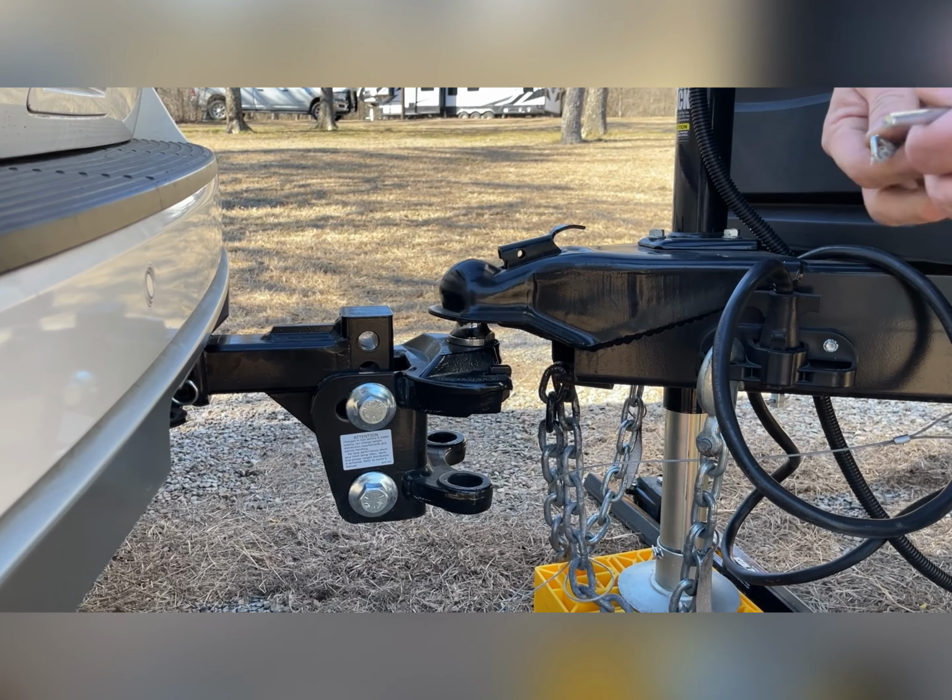Okay, you'll notice that it did release from the vehicle. If it was a push on the vehicle, you'll see that it moves a little bit. I've got our car currently in the parking brake on, so it's not going to move, but it has been released. Go ahead and lift the trailer so that you have clearance with your ball and the coupler.